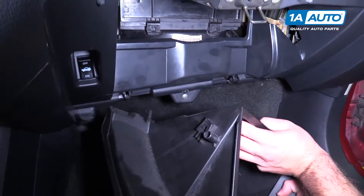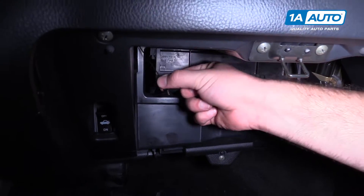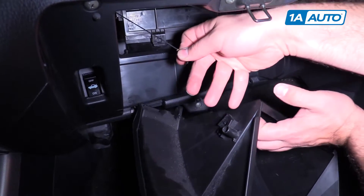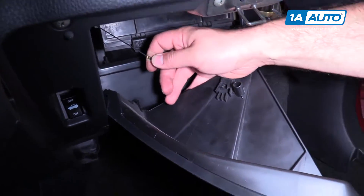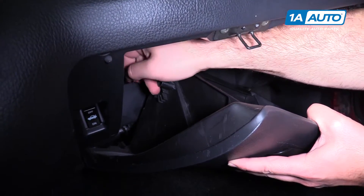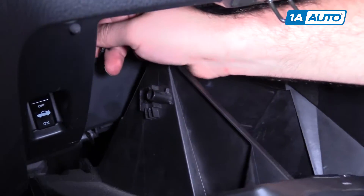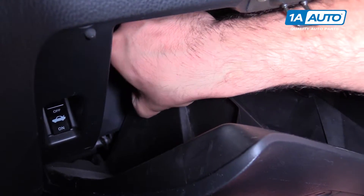Reinstall our glove box. Now you don't want to forget this — it's up here, it's the tether. It's like on a spring or damper, so when you open the glove box it doesn't slam open. It's got a hook into the glove box. You've got to lift the glove box up and try to slide this little button into the side of the glove box. It's a bit tricky to hold the glove box up. All right, I got it.